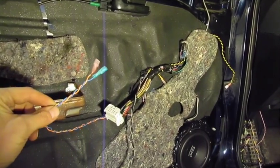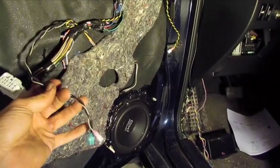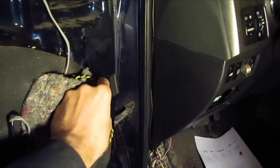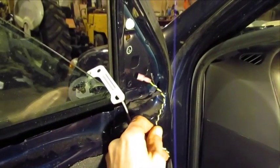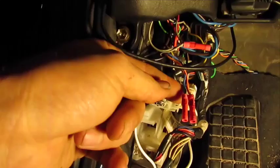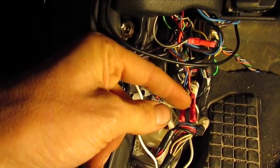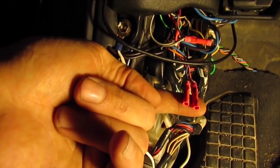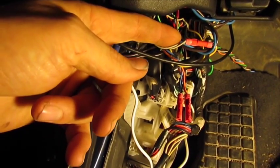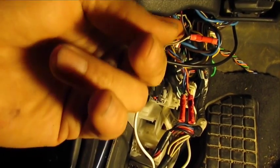I terminated my ends — this is for the ground lighting, this is for the panel lighting — and I've added an extra ground wire so I could branch off the turn signal wiring and run it up to the corner to make a junction, so I don't have to remove the door skin if I decide to change something with the turn signal. I've got the driver and passenger side ground lights here, crimped with one end open if I want to add something else to that circuit later. Same with the panel lights, driver and passenger side. I sourced that from key-switched power, but you could hook it to the parking lights if you wanted.